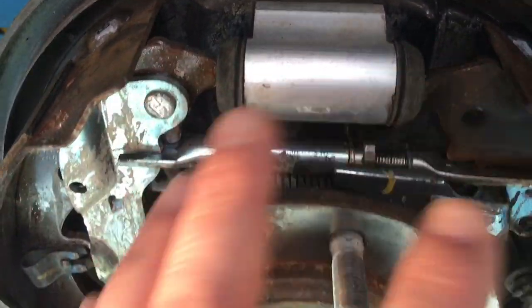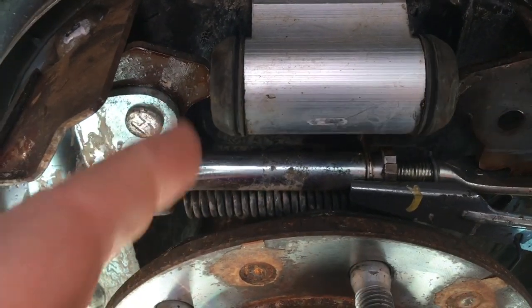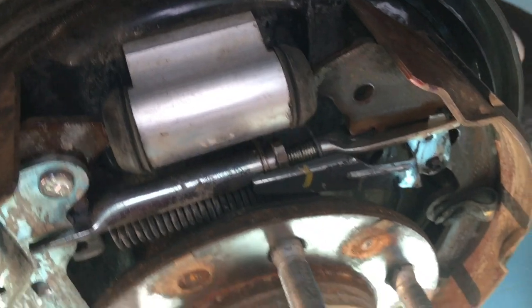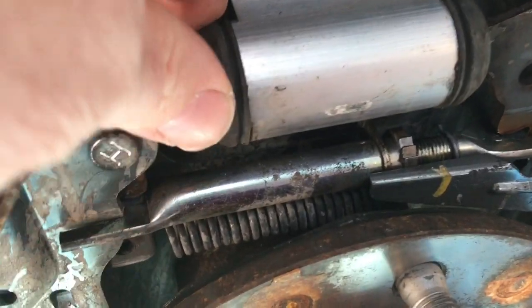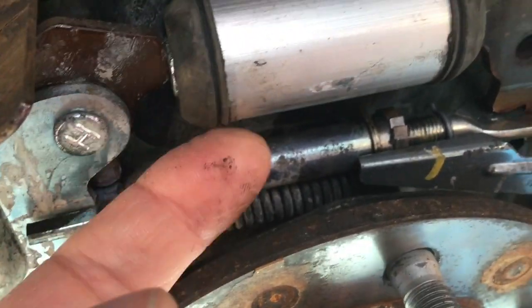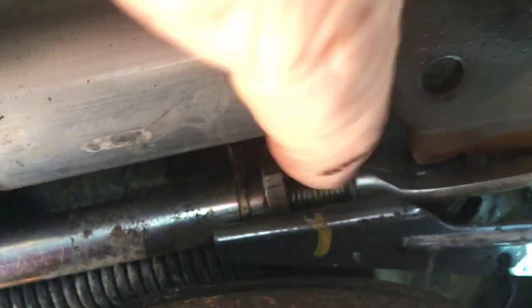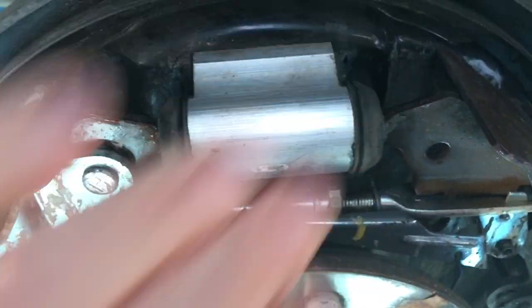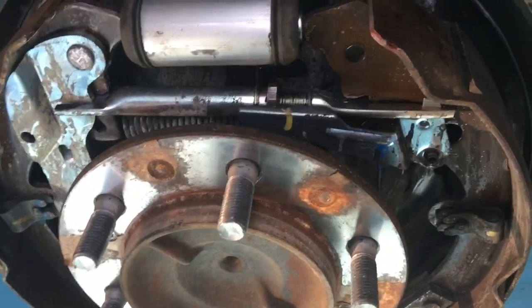What I used to do — and a lot of places will do this — is open up the wheel cylinder boots and have a look in there. In this case everything's been cleaned up, so I'll show you: you can just give it a squeeze and you'd feel and see the fluid pressure in there. If they're leaking, you press and it leaks out and you see the mess everywhere. Because it's clean here, we just check — no fluid leaking out, that's just the dust boot. Check each side because the seals are independent. Happy days — wheel cylinders are good.